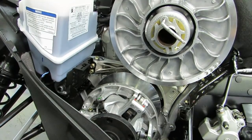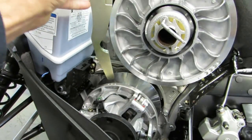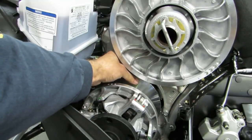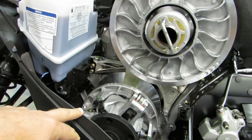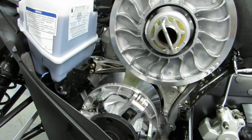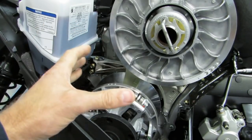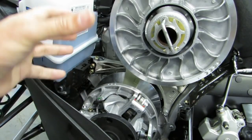The way you do that is you use their bar or a 3/8 inch thick straight bar. You place it between the clutches, then you close this clutch to pinch it in place. This is the X measurement up here, and on the other end of the bar is the Y that you can't really see — you pretty much have to take this side panel off to get at it. And then the Z is the distance between the sheaves. A couple of problems with this is they're only measuring in one plane, so you can be off in another plane and the clutches might measure okay but they're really not in alignment. And they don't build in enough skew so that under load the clutches are actually in alignment.